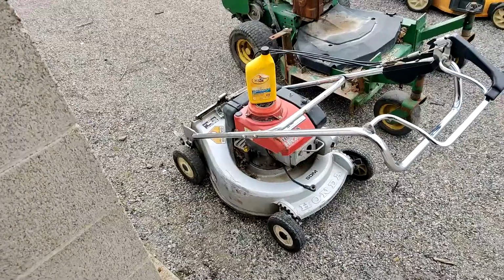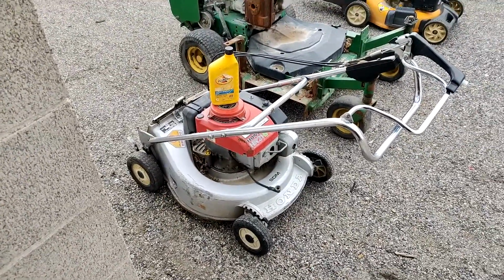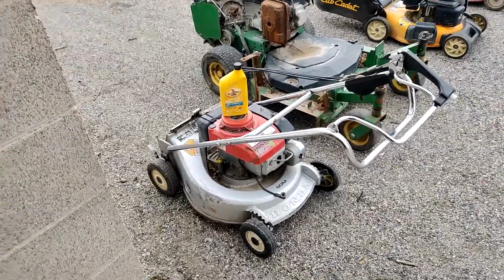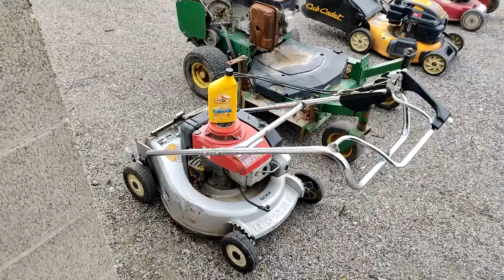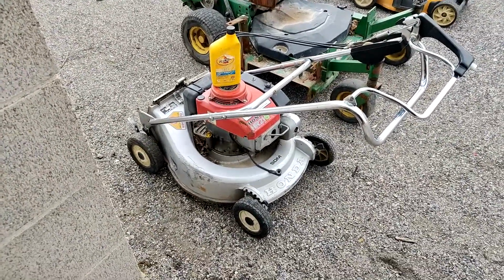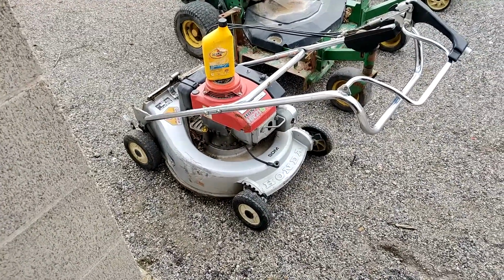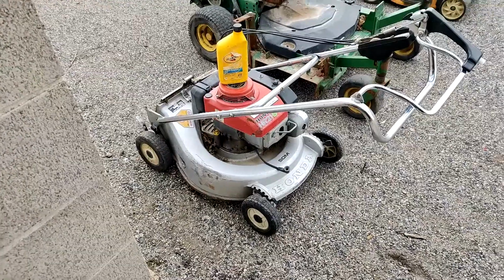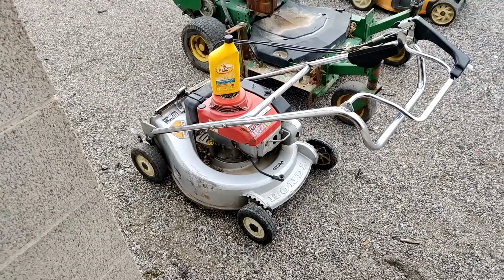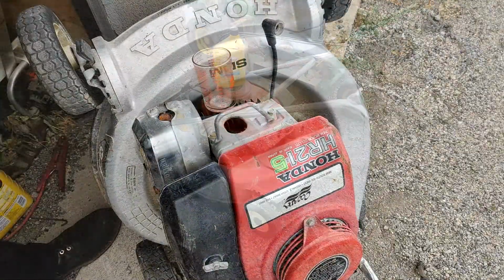You'll see a rust ring. I'm hoping it's just from sitting, and again, thankfully it's top dead center. When it stopped, that means that if there is a rust ring, it's going to be in the very, very top of the cylinder, which is like the best place for them. So let's go ahead and get that diesel and stuff in there. I'll probably do it off camera. I don't have my camera stand today. Or do I? If I find my camera stand, you'll see me mixing that up in the next video.